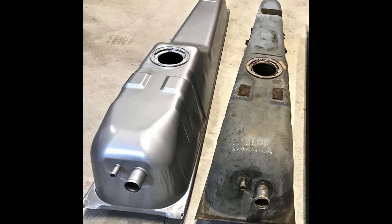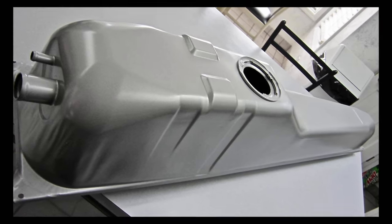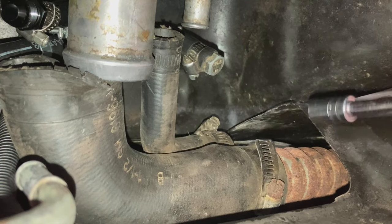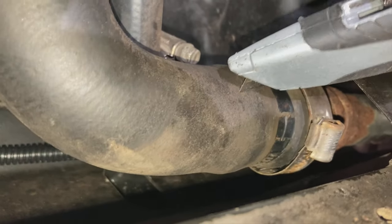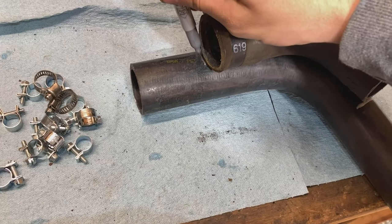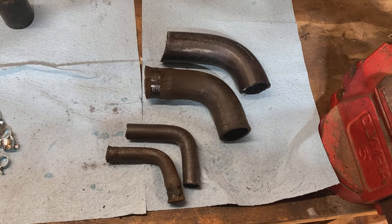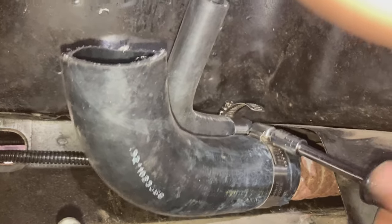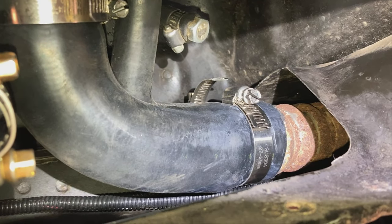In case you decided to buy a new Rodney Dickman fuel tank, these are probably not ethanol compatible. I asked Rodney what he coated his tanks in and his answer was zinc. If the interior of the tank is truly zinc, then this will react with ethanol fuel and cause corrosion. I decided to replace the filler neck hose and the vent tube hose with some ethanol rated hose instead. You might need to cut these things off — always cut away from yourself. You're going to need a tight 90 degree bend on both of these hoses. Grab the old hose, put it along the new one, and mark it for length. The coping saw works pretty good for this. Clean off the excess rubber bits that come off when sawing. On the top hose the shorter end goes towards the filler neck, and on the bottom hose the longer end does. Replace the hose clamps with some stainless ones — most bigger hose clamps use 8mm sockets.